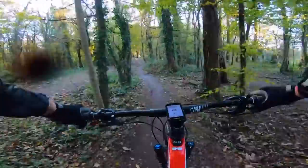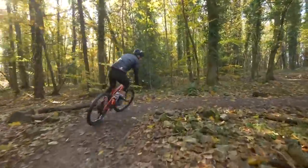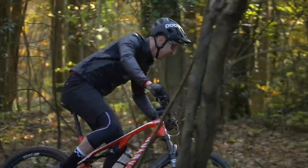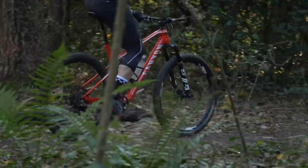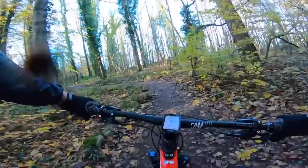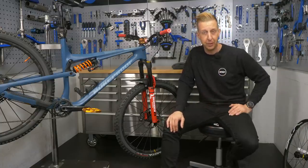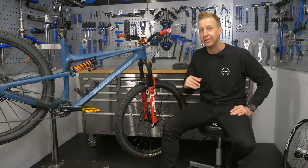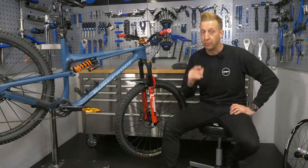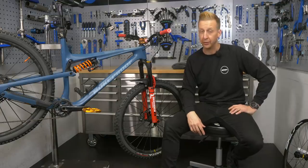For example, my Canyon Luxe — a cross-country bike — has an 80-millimeter stem with almost a negative rise, flipped. That's a very long stem compared to this 35-millimeter one, but it's the correct length for that bike and for the way it's intended to be ridden. You can see I'm riding it just fine. It's a cross-country bike — it's not supposed to be jumped and hammered around. Putting a short stem on it would change what the bike's intentions are. Whilst a short stem may make certain bikes handle well, it's going to make others handle really badly.